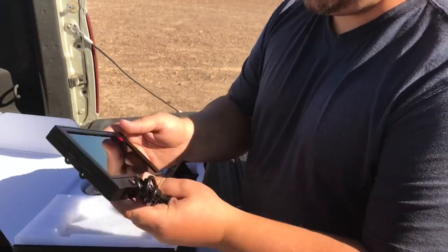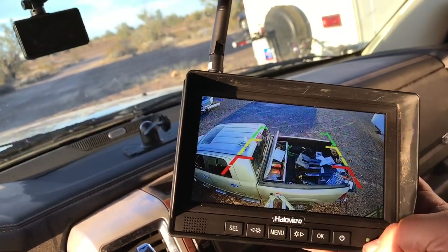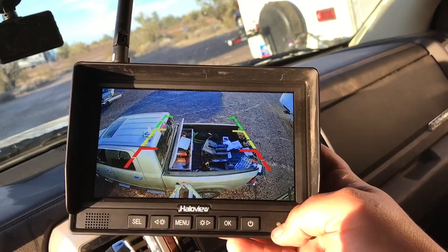I don't know if that was a wiring issue in the truck or in the back where the camera was — it was only just for a little bit, and then we didn't have any issues. A few things I want to talk about with the monitor: make sure to take the film off the screen — there's a little red tab up in the corner, just peel it off. You can adjust the brightness — I highly suggest figuring out how that works and using it, especially when you are driving at night. This has a night vision mode but it gets really, really bright, so if you're driving at night, turn the brightness down so that it is manageable for your eyes and you're not losing your night vision while driving. Another cool feature is that this is a depolarized monitor, meaning that if you are wearing polarized glasses to help cut down on glare, you will still be able to see the image on that screen.